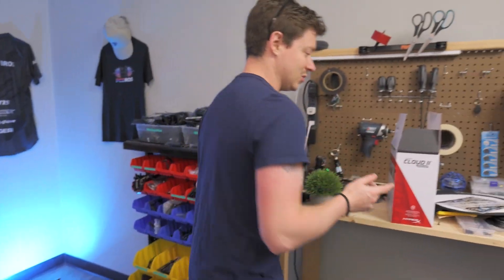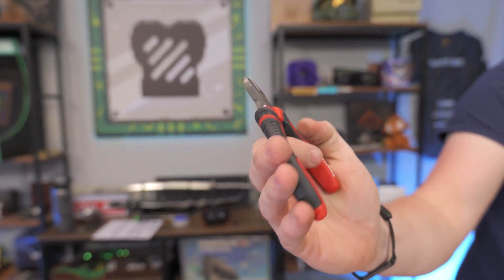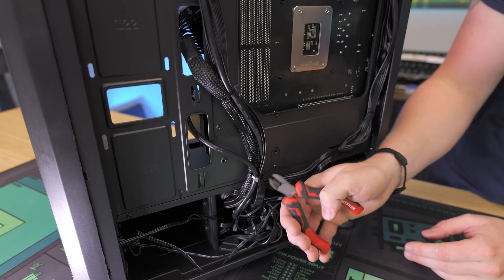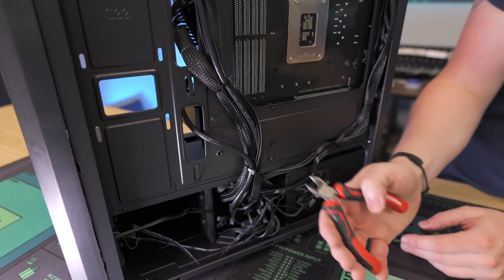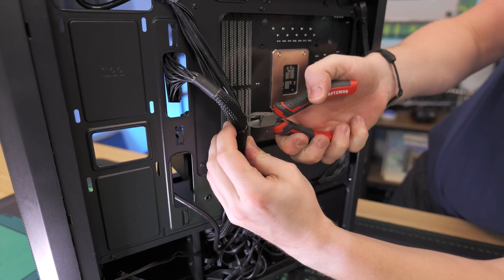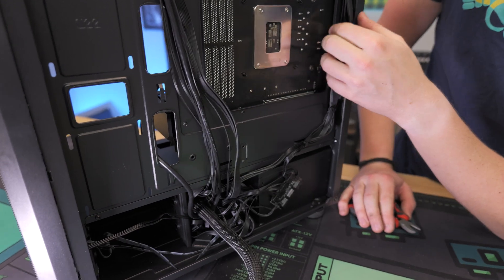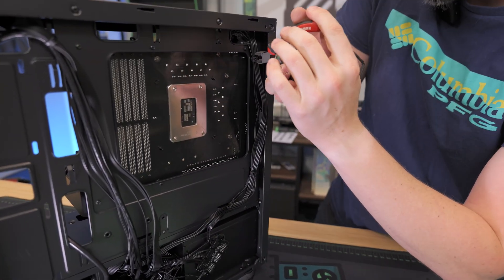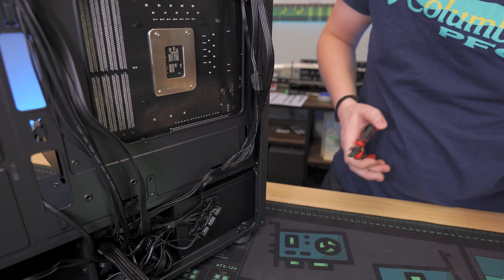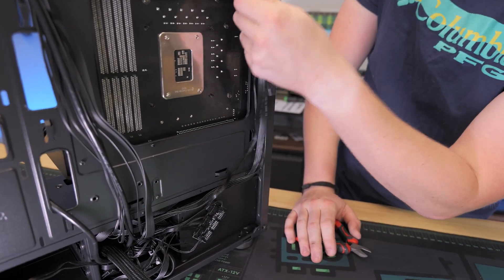First thing — unplug your power supply too. The switch was turned off but just for safety reasons. I really recommend having these on hand — we call these snips, basically a close-cut snipper that can cut through really strong things, even metals. You want to use them like scissors because if you accidentally get too rambunctious and cut one of your cables, that really sucks — you might need to do some soldering or even have to replace components. So we're basically just going to snip the things we absolutely have to. Every case is going to be different and honestly every person that builds a PC is going to zip tie stuff differently, but it's the same concept every time.